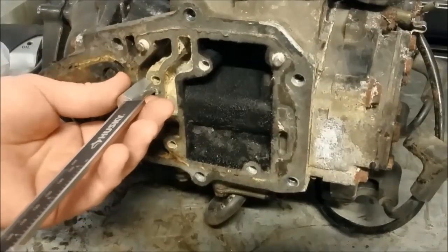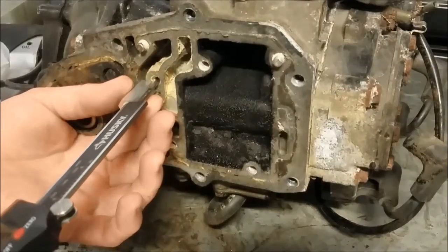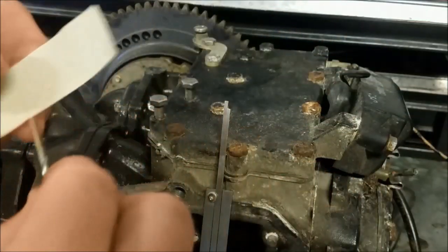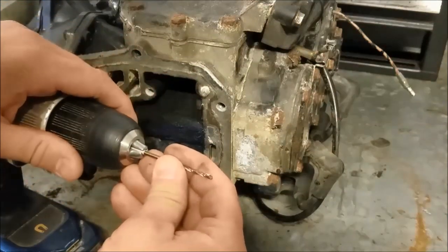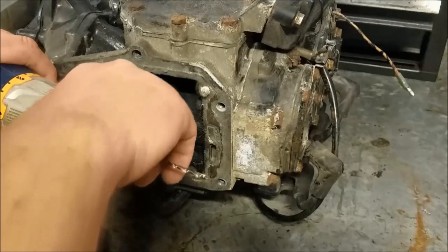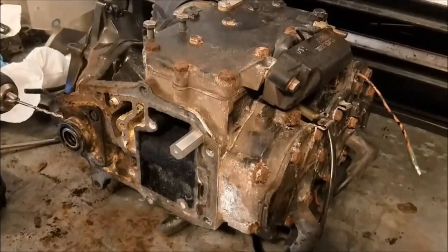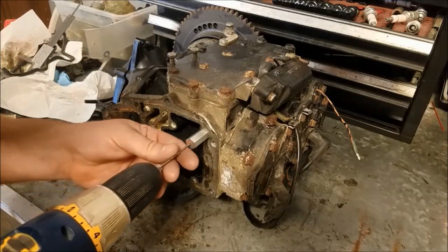What I'm doing here is using the tool I just made along with a little depth gauge — that's how far our drill can go. Anything past that and we may drill into the block. That's the base of the tape — the absolute deepest we can go. There's not much room here for the drill bit and the tape, so I'm going to make the tape go to the very end of my drill jaws. With the fixture on, that's as far as we can go. I don't really have to worry about the tape stopping me when the drill will do it for me. Let's thread that in.